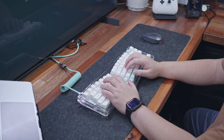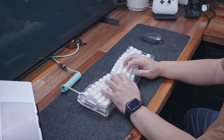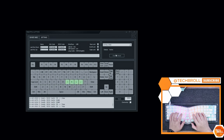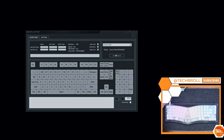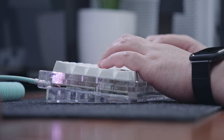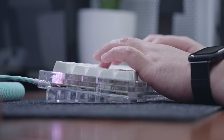As for performance, I didn't encounter any notable issues when it comes to wireless stability. However, NKRO is only limited to up to 4 keys on both Bluetooth and wired mode, which is kind of a letdown. I don't know if there is a specific key combination to toggle it, but right now it's only up to 4 keys at the same time. What's good is that you can connect this to up to 5 devices, compared to other keyboards that are limited to only 2 or 3.